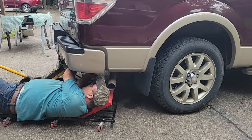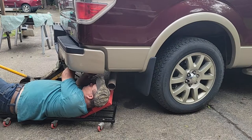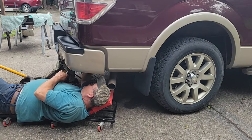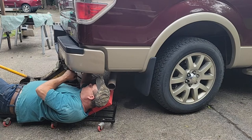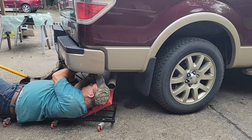They're not too bad to tighten up by hand. When you're pushing, what I do, instead of hanging on the wrench like this, I open my hand up. So if I slap something, I'm slapping instead of smashing my knuckles. Dawson helped me change the oil the other day, and he doesn't understand that yet. Protect yourself at all times, don't put yourself in a predicament where you're going to get hurt. He punched the sway bar when he was loosening the bolt up, I guess. He couldn't get the wrench on. Short wrench, he couldn't get any torque. So I think he put a wrench over a wrench and then he punched it. And that's not good. Always take your ratchet and push like that. Then you're slapping something instead of punching something. Metal doesn't move too much.